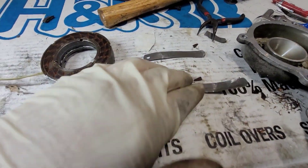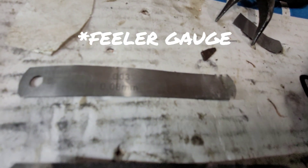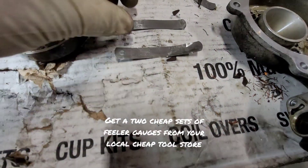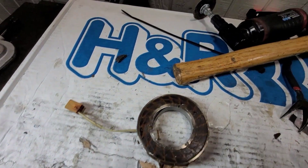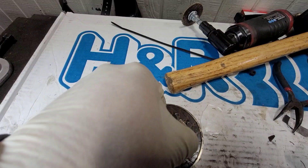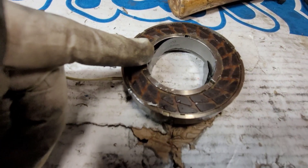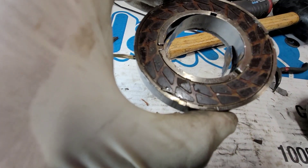What we found is if you use either two shims measuring .08, or sometimes one .06 and one .08, and stuff them down there the same way as the TSB specifies for the paper films — just like this, stuff them down in there. You might have to cut a little bit of one of the shims. The lock tabs get released and you just wiggle it out, and it comes right out.